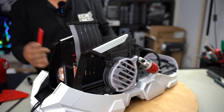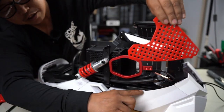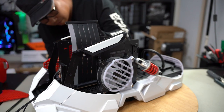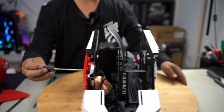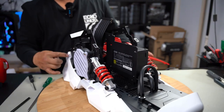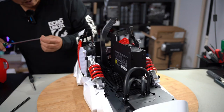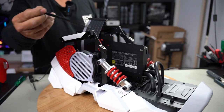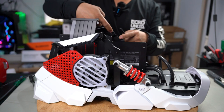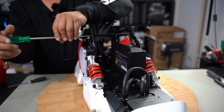Reinstall the Cooler Master logo — there's a platform it rests on, line up the screw hole and install. Now install the plastic side panels back in. The panel with two screws: line up the two tabs at the bottom into their slots, line up the screw holes and screw them in, then install the two smaller screws. The other side has one screw and the same two tabs — line them up and screw in. Reinstall the bar — one side has a little square, ensure that sits in the square, line up screw holes and install one screw on each side.